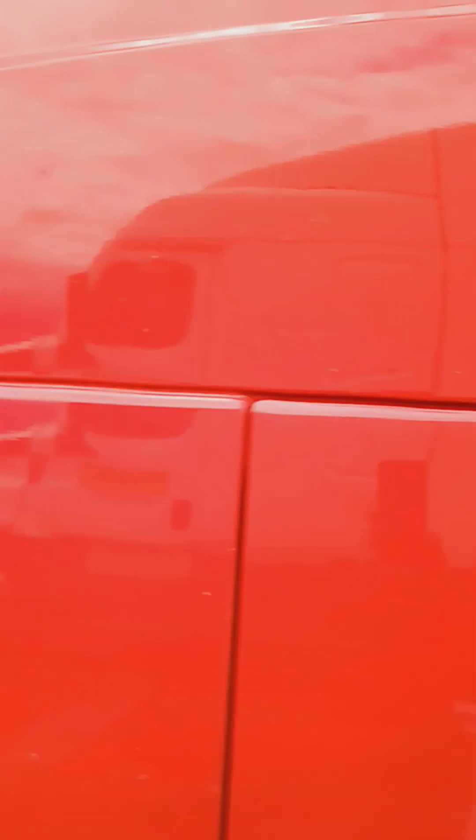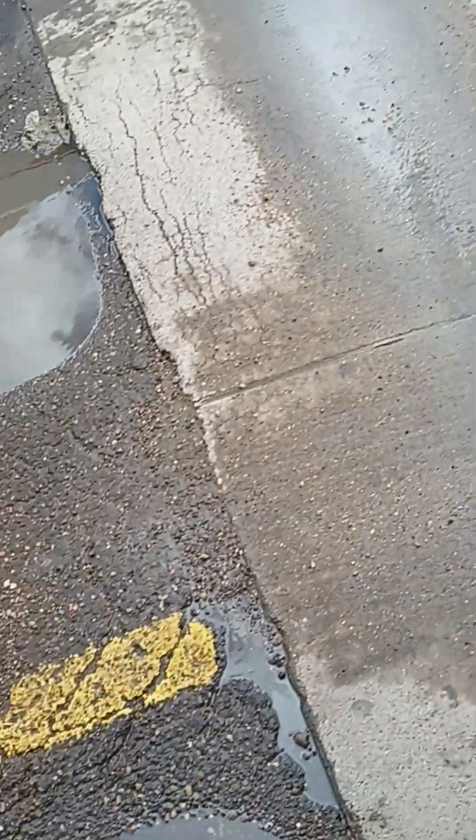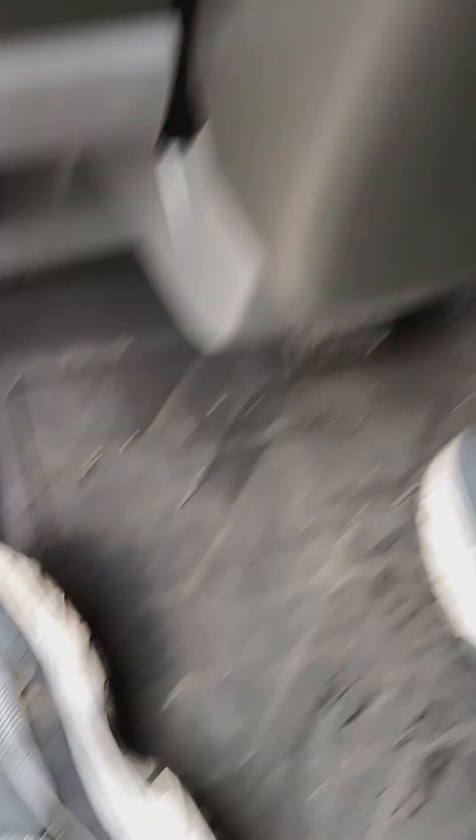So now I get to kick back and do some housekeeping on my floor — that's why I hate walking and all that. I'm going to have to get a carpet because of what it does to my floor, but that's just on the driver's side. Just wanted to share that with you guys, show some behind-the-scenes stuff. Normally you guys all see trucks on the highway, but for those of you not familiar with this industry, I showed you guys what all we have to do — unlock the kingpin, the fifth wheel, lower the truck to get out from underneath, lower the landing gear. You guys will learn all that once you get in trucking school or try to come out here.